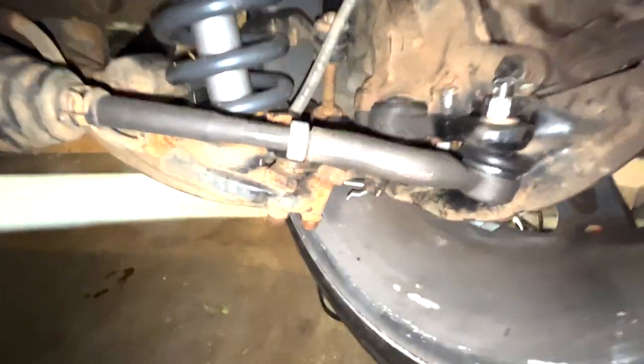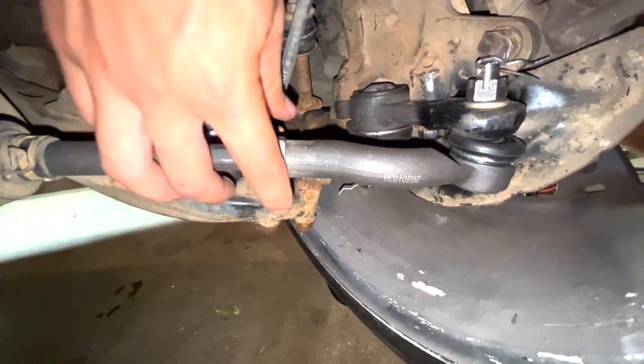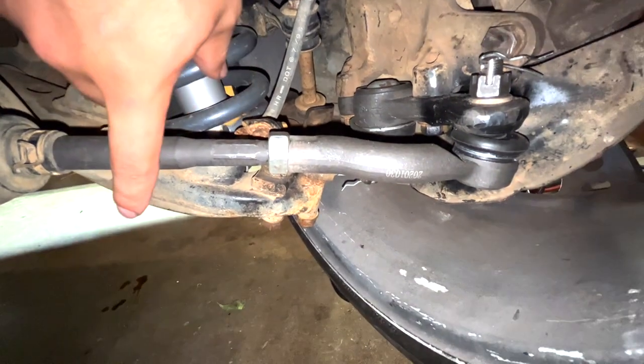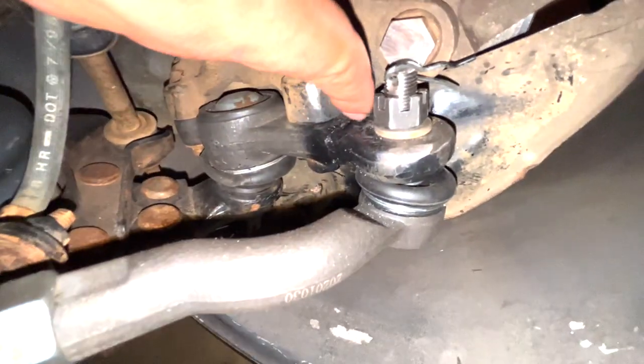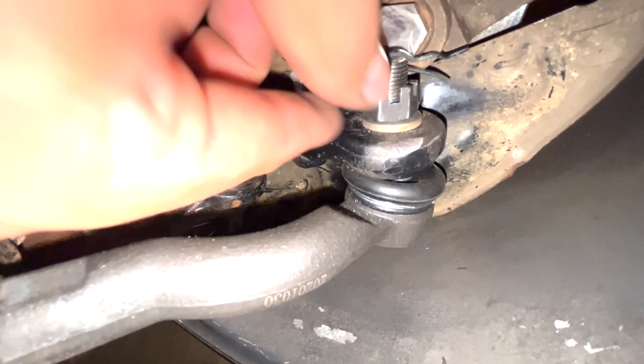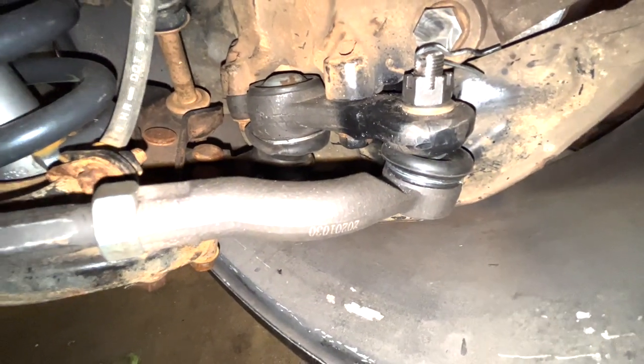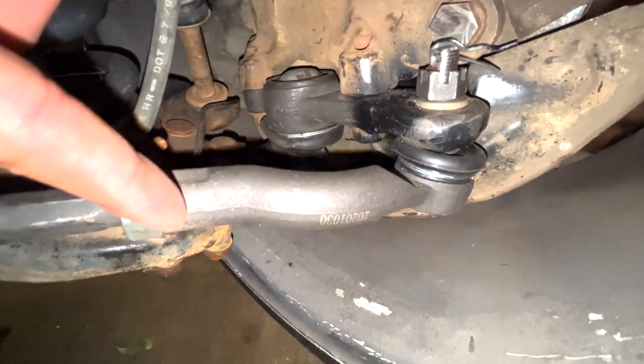This is it — I have the shortened tie rod itself and the shortened inner tie rod. I did need a crush washer on top and I needed to shave the bolt down a little bit so the threads will clear and I can get a full lock on this, so I don't have any wandering steering. That side is pretty much all buttoned up. Everywhere I've tried to get an alignment has refused to do it on my truck because they require factory specs — I tried to reason with them since I was just looking for something straight, but everyone refused.